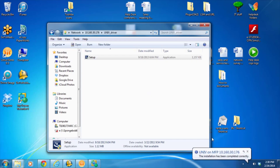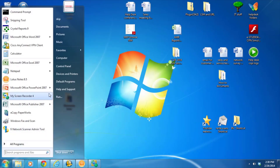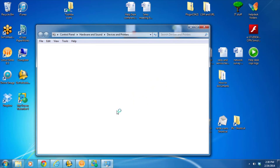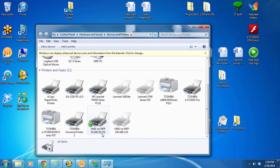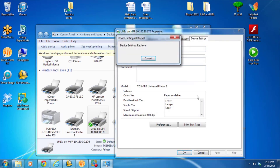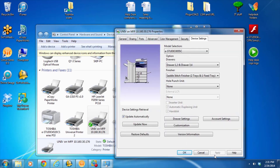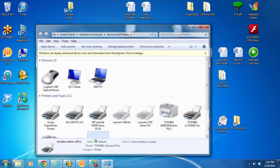There you go — right in the corner you'll see it popped up and said it's loaded. To verify, go to Start, Devices and Printers, scroll down and you'll see it listed as the IP address you assigned. You can go ahead and rename it by going to Printer Properties and just rename it what you want — for example, Toshiba Admin Office. You can also do a device setting to make sure it has all the accessories, then hit OK. And then it's renamed right there.